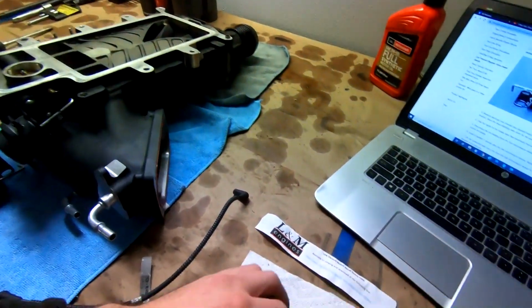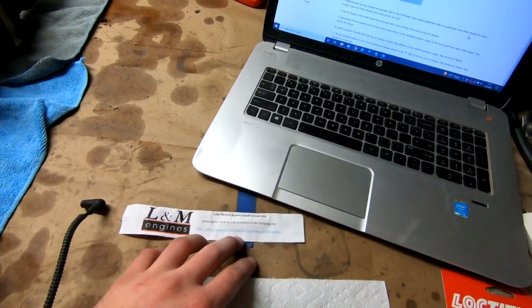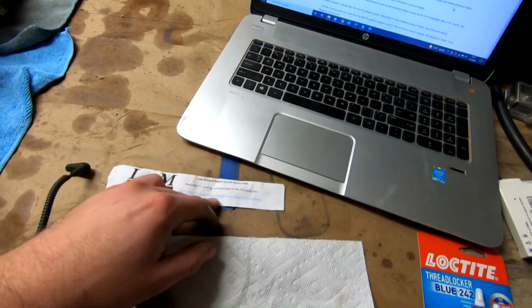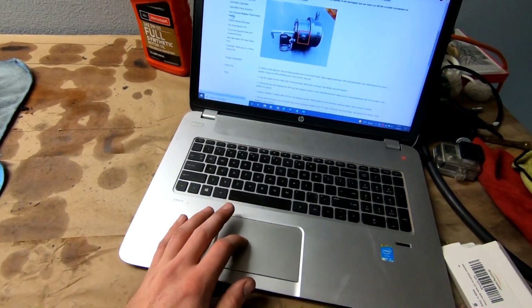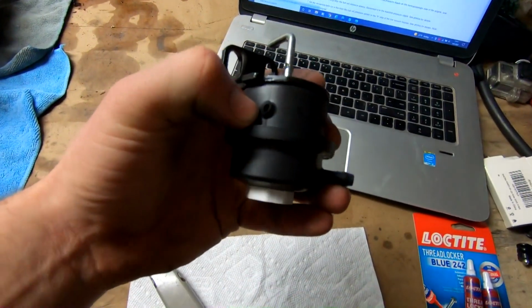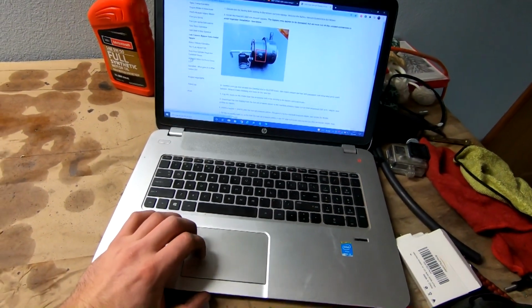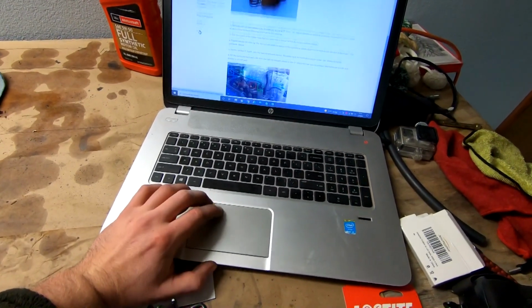All right, so I just pulled up L&M's vacuum bypass install instructions. Looks like the URL changed since the link they gave me. Doesn't matter. If you go to their site, go to tech, you'll see the low vacuum bypass valve install details. I thought it was broken because I just noticed this piece was missing. Turns out that's on purpose. It says the bypass may appear to be damaged, but they have cut off the unused connection to avoid improper install. So we don't need to use that.